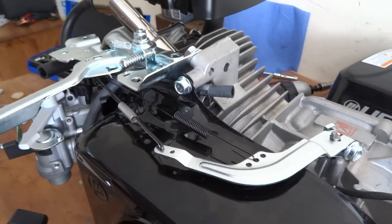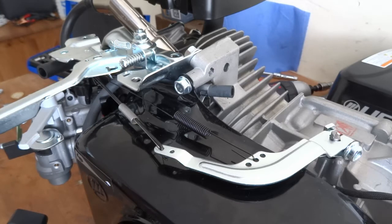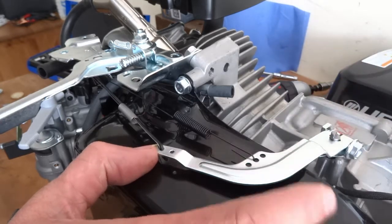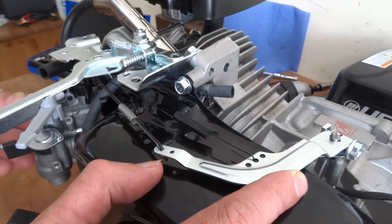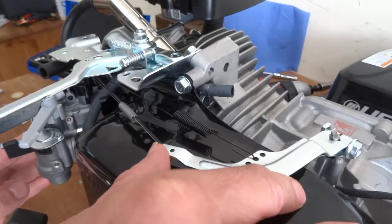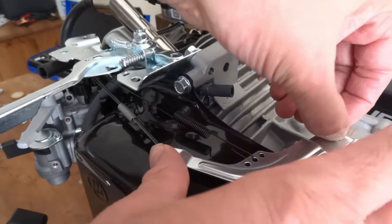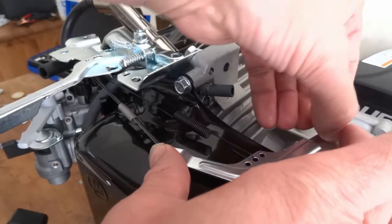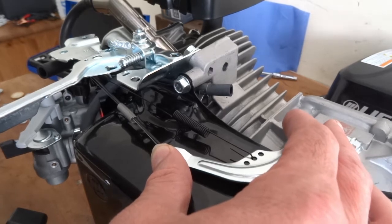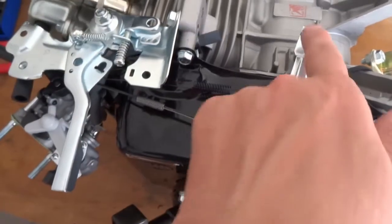The other way it opens the throttle. This little spring gear stops surging — if that's missing you can get surging when it's trying to run. To set the governor, loosen that nut, make sure the throttle is in the closed position, throw it into the fully open position, then tighten the nut up. Make sure that the shaft is fully turned and touching the inside of the centrifugal weights, then just tighten it up. That is all you have to do to set the governor.